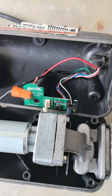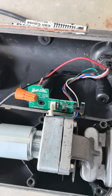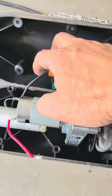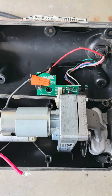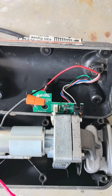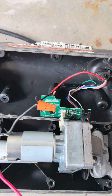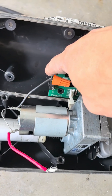I bought a new counter board, which is very cheap — about $15 on Amazon — but it didn't really help. Then I actually realized that when you retract the arm all the way in, you have to make sure this part is touched and clicked in. Once it's clicked in, the motherboard knows you are at the fully retracted position. So then if you click your remote, it will extend all the way out. Make sure this arm part is fully touching this switch before you test it.